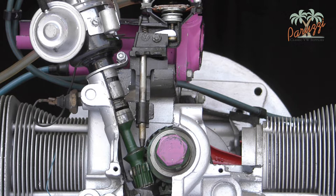To disassemble the distributor drive shaft, you need to take out the fuel pump, as the fuel pump shaft pushes against the distributor drive shaft. The distributor drive shaft can never come out without removing the fuel pump shaft as well as the fuel pump flange. Let's get started disassembling the distributor drive shaft — the procedure remains the same for all Type 1 VW engines.